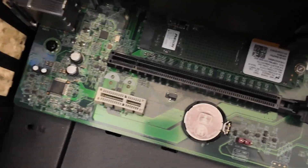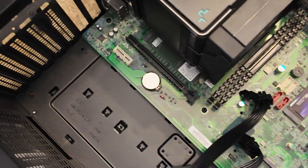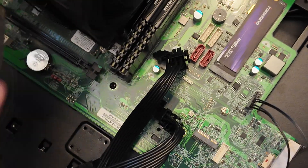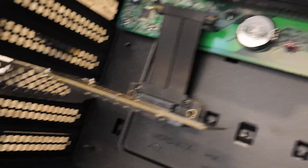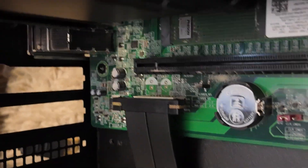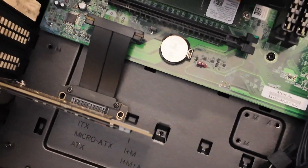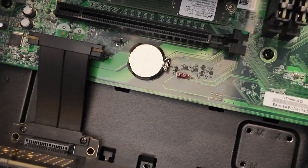With the case open you can see that 1x slot. I'm not sure how far down the cable can reach, but it looks like I can go down to the second slot from the bottom — that should work as long as the video card clears the tiny extra gap. I'll go ahead and install the cable now. It's all bolted in and pressed in firmly — there are no clips, it just sits in there securely. Let's get the video card back in.